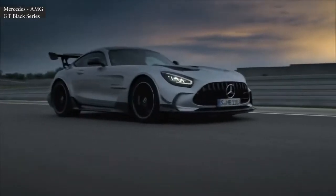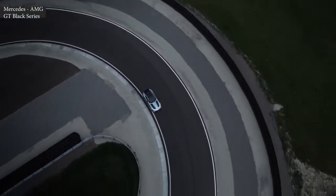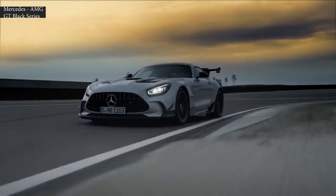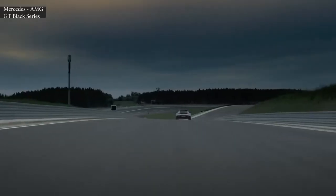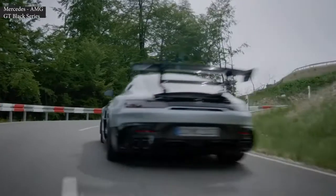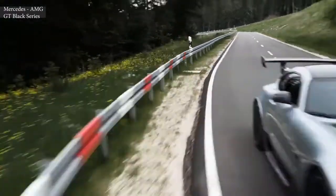Another detail in this context is the flap placed in the upper rear wing panel, which can also be electrically adjusted. It improves longitudinal and lateral dynamics. The wider wing support allows a lower flap position with the same amount of downforce, meaning a higher wing efficiency. The whole wing system is designed with lightweight construction in mind.